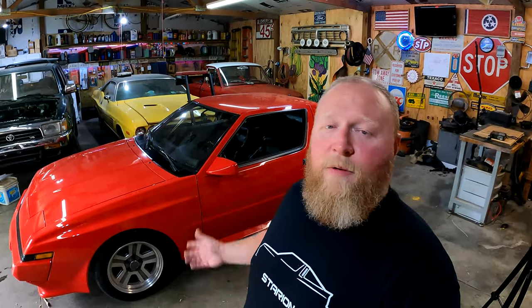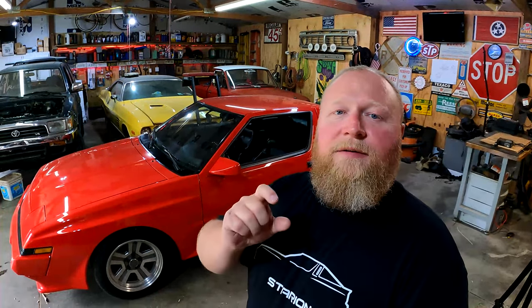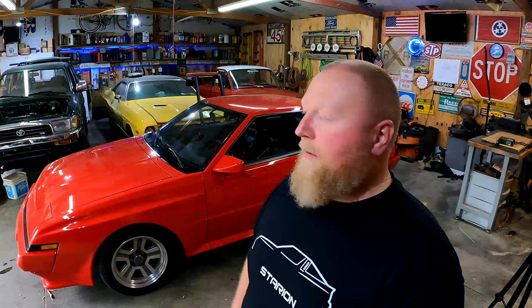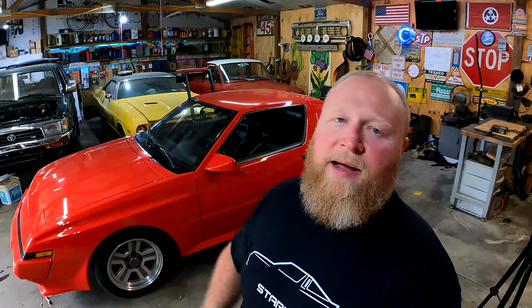So I think in order to have a factory radio in this car, which I do prefer, I'll have to probably send one out for repair and just pay somebody to go through it. Also, the tape decks haven't worked on any radio I've touched, seen, smelled, tasted, or found. They're all dead. And it's not belt problems. I replaced the belts on all mine. There's an IC module in there, a little Motorola chip, I believe it is. Thing dies or goes bad or something happens to it, but it's the logic that controls the tape deck itself. It'll pull the tape in and then spit it back out pretty much across the board, everyone I've found.